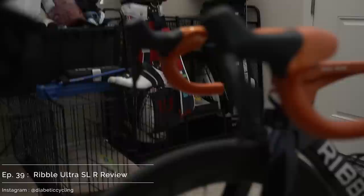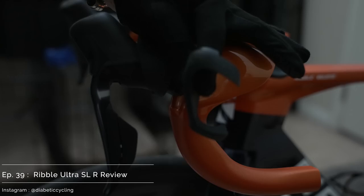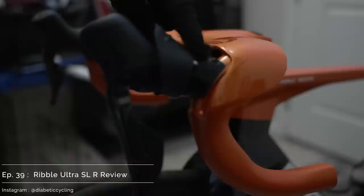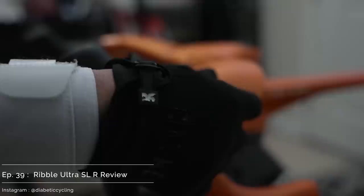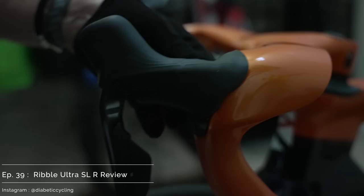All right, so you are familiar with the way shifter hoods go, right? So when I peel the shifter back, what you get is this plastic gasket fitting looking thing. What that is doing is, with the way the bar is shaped here with the direct mount shifters, there's a bit of a gap. So this rubber piece is a somewhat loose form fitting. It's gonna sit as so, and then you peel your hood back. Basically, your hood is what secures that rubber gasket